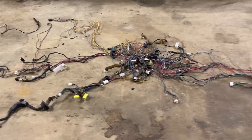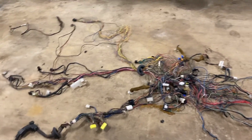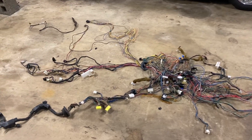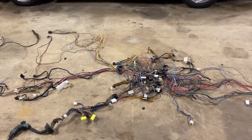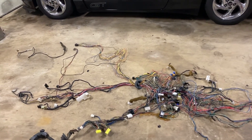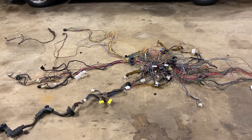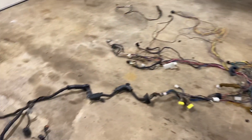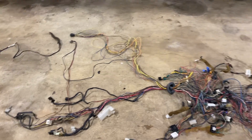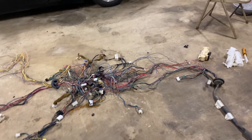You can use the standalone to control the engine and tune the car. The only thing is, I'm also trying to figure out how to keep the car held in second gear. I'll probably end up putting a kill switch on solenoid 3 so that once it goes from 1 to 2, it can't shift from 2 to 3. I'll probably shut solenoid 4 off as well so it holds the car in second gear. This is definitely a crash course in automatic transmission building, because I had never built an automatic transmission in my life. But the slush box build came out real good.